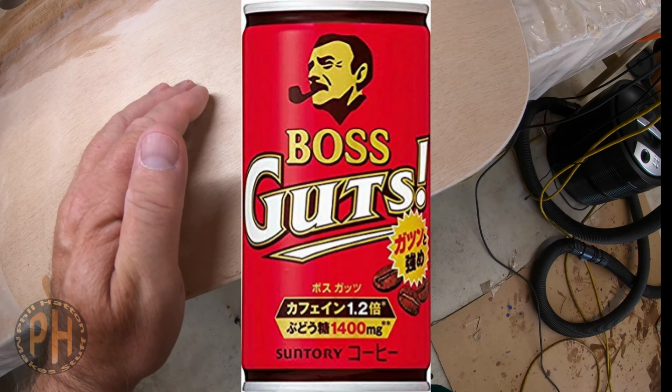The doors and door frames need sanding around the edges, and since you'll be epoxying parts together, you should go ahead and sand any epoxy where you'll be attaching the windowsill, the door stiffener, and the fairlead boss. The fiberglass tape you used on the inside of the door also has a ridge on one side.